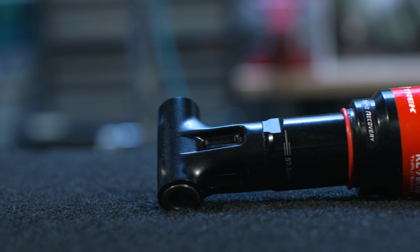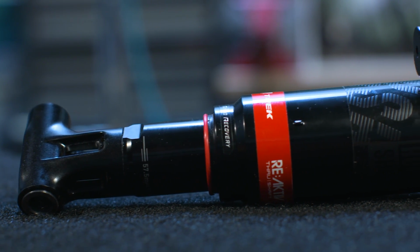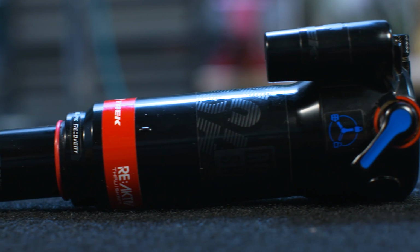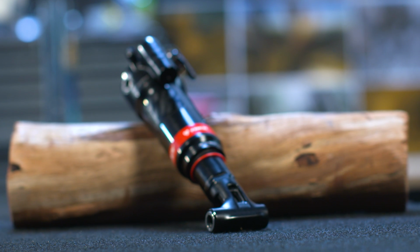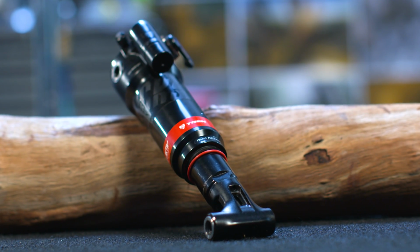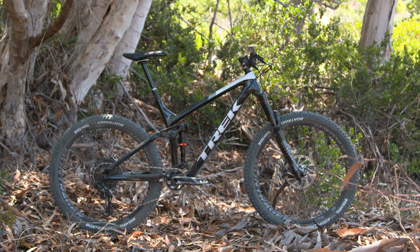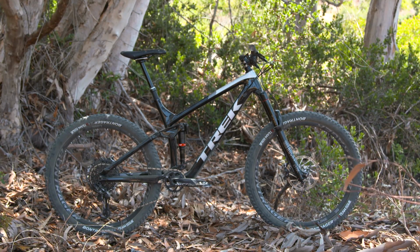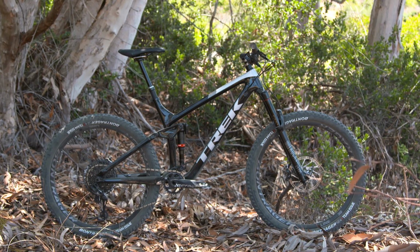Yeah, I mean, the reactive was borrowed from Formula One racing, a company called Penske that's been doing high-end suspension tuning for a while. And they actually invented it because they outlawed computer-controlled suspension damping. So they needed something that was organic, but just as instant. Yeah. And I think they really do it. And there's really no cost to the performance of it. Where the shaft comes out of the bottom of the shock, there's really no drag in that seal, or at least there's a lot less drag than there is around an IFP. And the service intervals are the same as on a traditional shock.